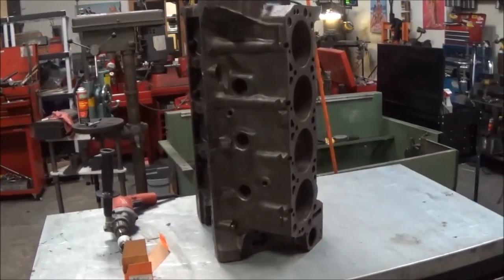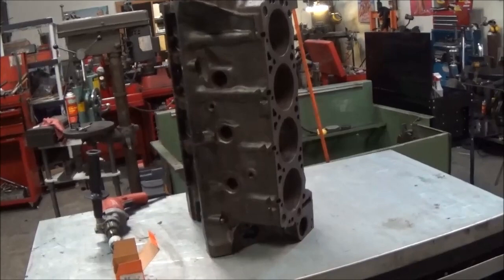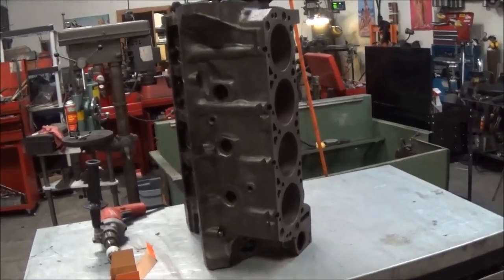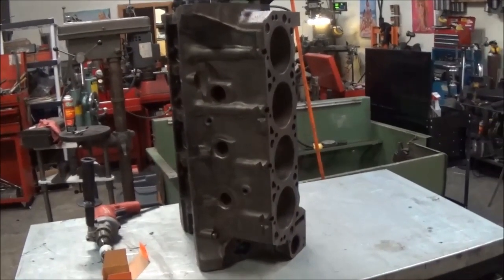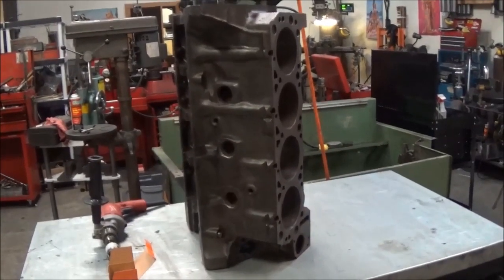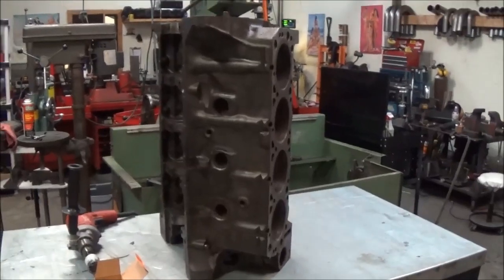We won't know till after, but basically what this is going to consist of is a 6.9 base 7.3, like I said previously. We're going to a 4.040 bore on it. It has 6.9 pistons, but we actually took turbo rods and bushed them down to the smaller pin size. We've never had an issue running the smaller pins on high boost applications. This engine here is actually going to see a 150 pump, maybe right around the 400 wheel horsepower range, all said and done. So it'll be a good test for NA pins, but I don't really see a worry with the pins. The rods are a weaker link than the pins are. So we'll just go ahead and run this.